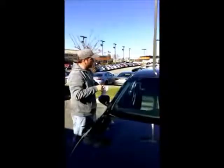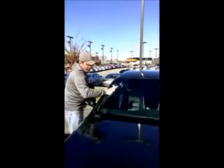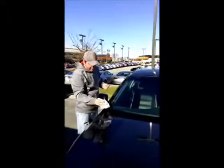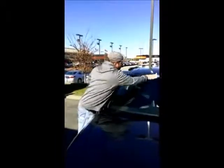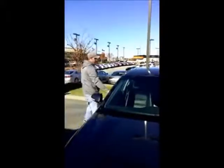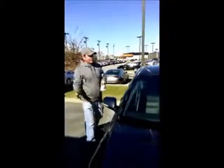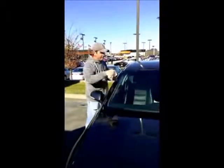After the windshield has been installed, the tape needs to stay on for 24 hours. No high pressure car wash for 48 hours. The vehicle can be hand washed, but the high pressure one could possibly puncture the bead, and then you'll get wind, water, everything you don't want. And don't slam your doors. If the window's cracked on both sides, the air can escape out of that. If not, you would want to just push the door closed, just like that. If you slam it with the windows up, that air tries to find the easiest way to escape, and right now it's going to be through the wet urethane bead.